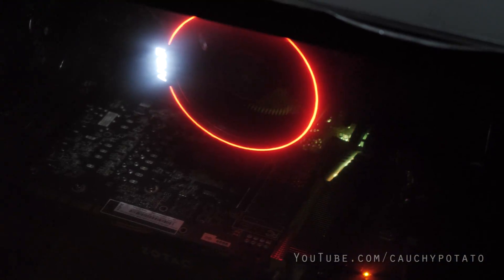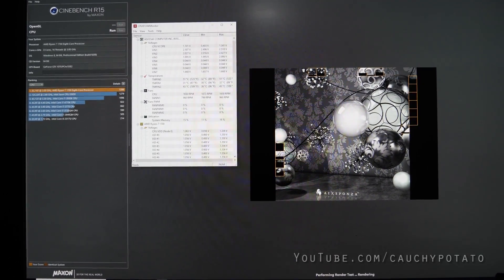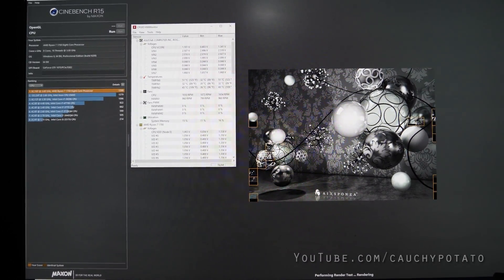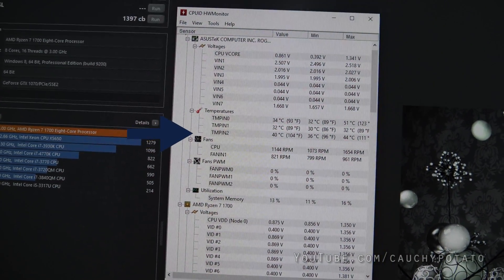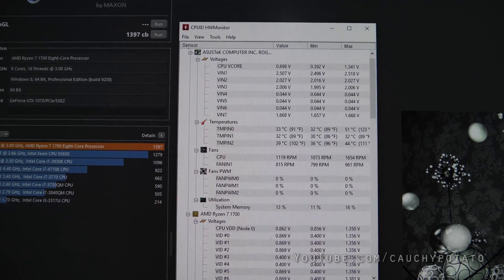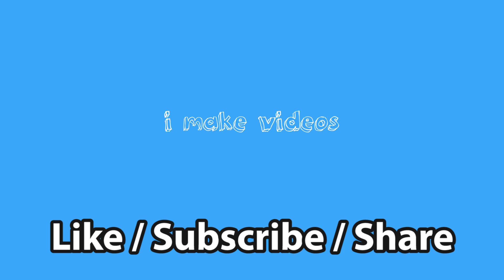The Wraith Spire cooler is pretty neat with its red circle LED light, but let's see how it deals with thermals while running a benchmark. The min and max temp values are seen here on HW Monitor, which is a free app you can use to view various temps throughout the computer's internals. 30-ish Celsius on the minimum side and 50 Celsius-ish on the max side — 30 on the low side is idle and the high side is reached while running the benchmark. I can attest that this computer runs stable, as I've already ran some gaming benchmarks on this machine. And that's it — the CPU and heatsink install was a success. Hit that like button if you found this video useful and leave a comment if there are any more pro tips in PC building that myself and the rest of the internet can find useful.